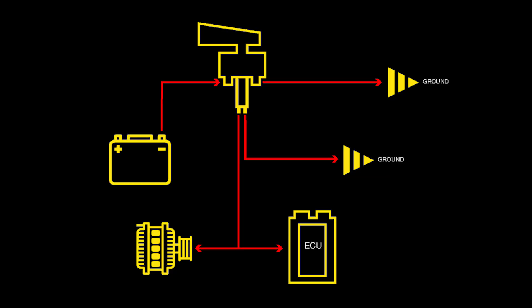This is typically a four-pole switch which has two big terminals and two little terminals. The two big terminals go in line with the battery positive cable, while the two little terminals are used to disable the alternator charge or kill the engine management system. This way, when the isolator switch is turned off, the engine will turn off too — it won't be able to run solely on the alternator's output voltage. Testing the correct functionality of this switch is commonplace at most motorsport scrutineering, so make sure to do it right.